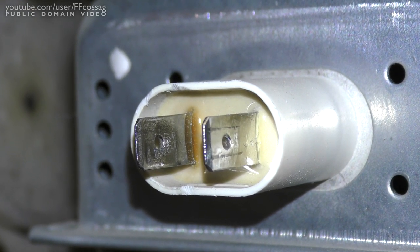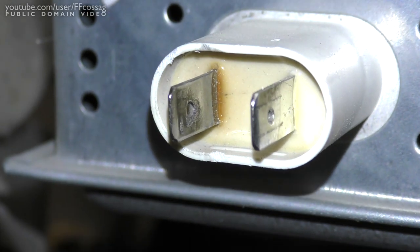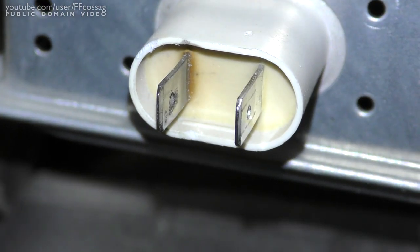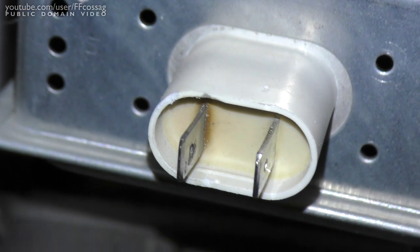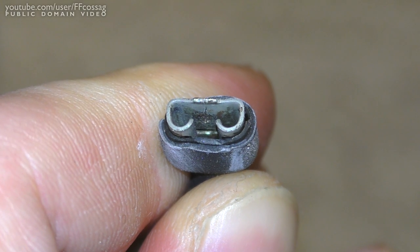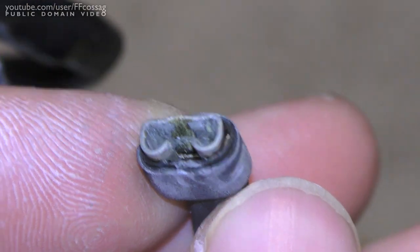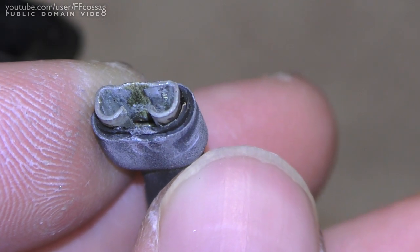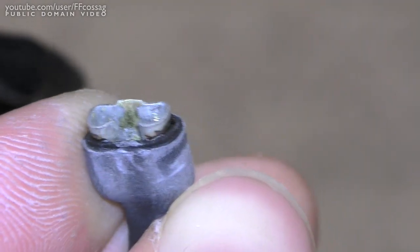Alright, I think I might actually find the issue on this thing, because look at that left contact there. I've been grinding away at that with a Dremel, and there are very, very clear signs of arcing, and that's run very hot. So I'm hoping, with some more manual labour, it's relatively hard to access due to the plastic shroud there. But once I get those arcing marks off, that's going to make a world of difference for this thing. Yeah, just look at that. That's been arcing for a very long time. Alright, through the very liberal application of sandpaper, toothpicks, alcohol and files, I think we've got this down to something close enough to metal for me to dare reconnect it.